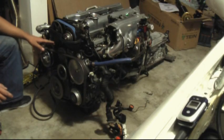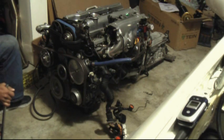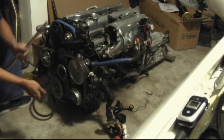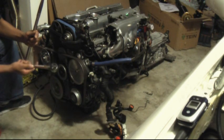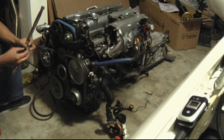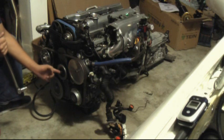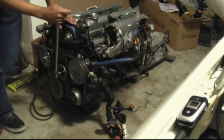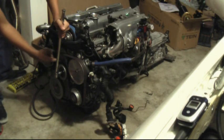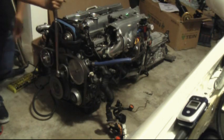The first thing you'll want to do is remove the accessory belt tensioner — it's this one right here. You will need a 14mm socket and I'd recommend a breaker bar such as this one. If you have just a ratchet with a half-inch drive it'll be enough, but it will take a lot more effort because this does require a bit of force to hold the spring back while you pull off the belt. Put the 14mm socket on the breaker bar and place it on the nut on the tensioner. Turn the breaker bar to the right and that will loosen the tension — you'll see the assembly move to the right and pull the tension off the belt. Once it's off, just one finger to slide off the belt, then let go.